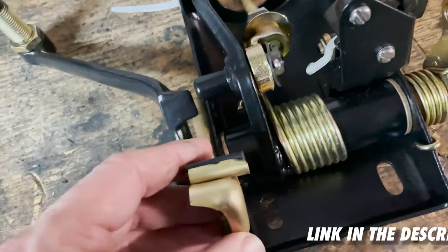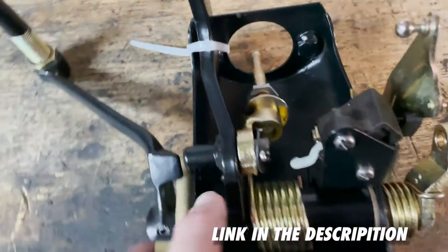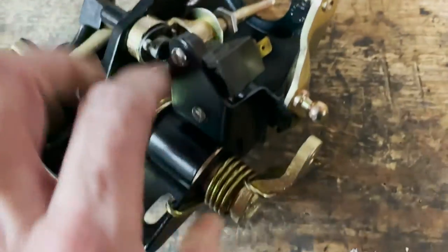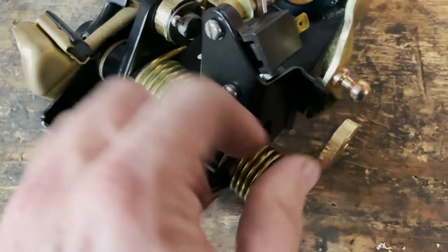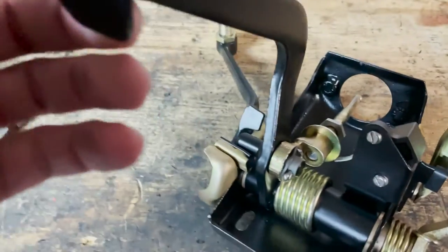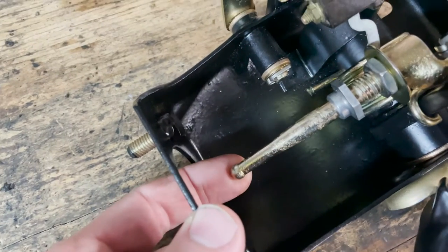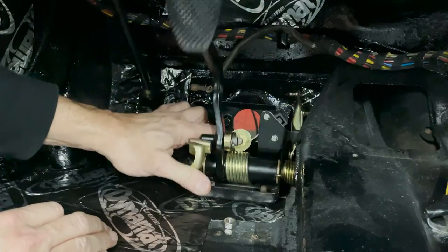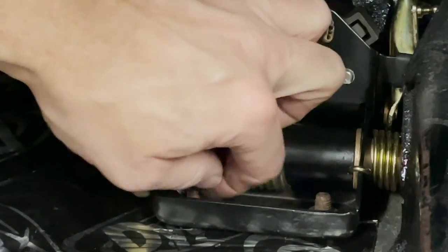It's important to have the correct clearance to the piston in the master cylinder so it's not constantly under force. The factory spec is one millimeter. Bruce Stone rebuilt this whole pedal set — you can see he's used powder coating for all the metal bits and new springs. The detail is really, really nice. And this is the business end of the pedal cluster — the part that goes into the master cylinder and contacts the piston. We'll seat the cluster on top of the bolts and then get some washers and nuts to secure it.